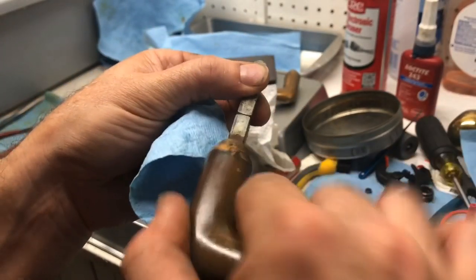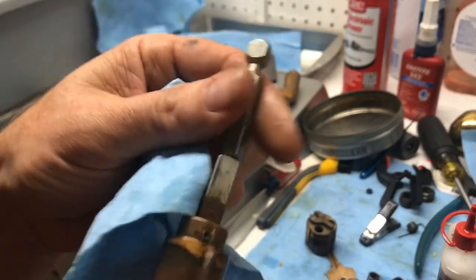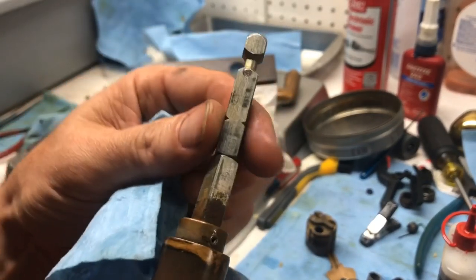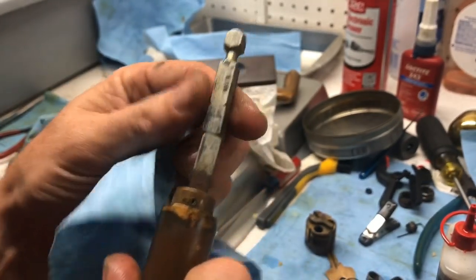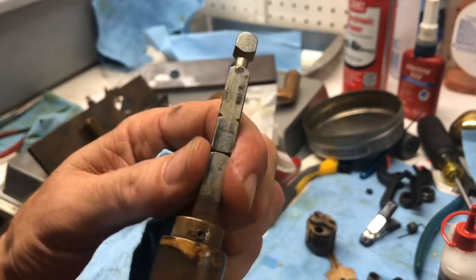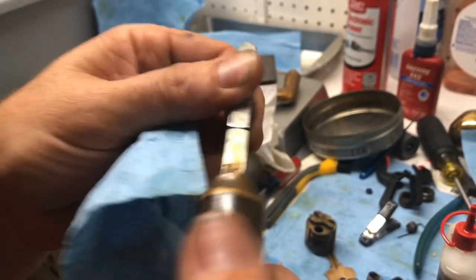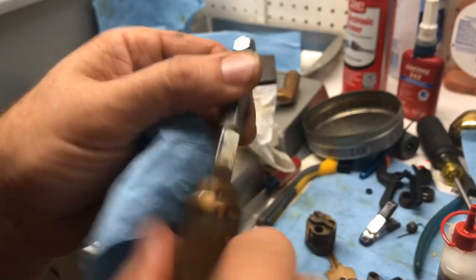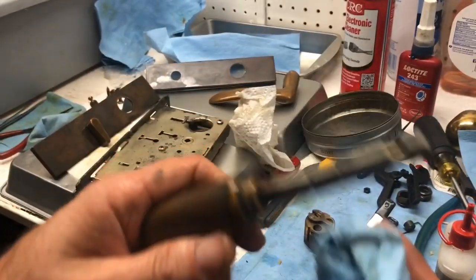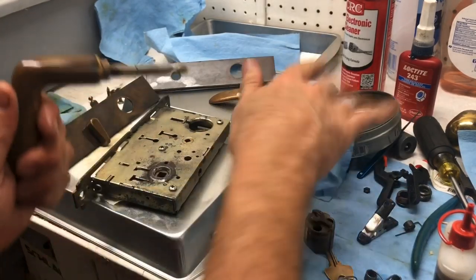And some locks do work if you pull up. Most people don't pull it up, but again, if it's tight, tighten down all the way like that, it's not going to work. So tighten it down all the way, back it off, line it up, and then turn it one more quarter turn so that you have the correct action for the inside and outside. It's one of the biggest problems putting them back on is getting that correct.